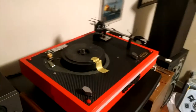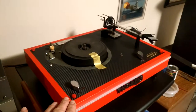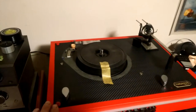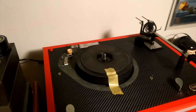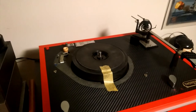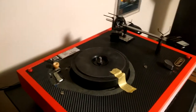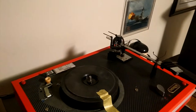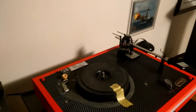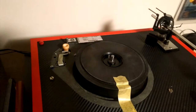The inner platter is where the post sits inside the bearing, and the bearing is probably the most delicate and most engineered part of this whole table - what really makes a Thorens table so good. The TD-165 is like the TD-160 but came with two different sized posts and bearings. The less desirable ones are the seven millimeter bearings; this one is more desirable because it has the same bearing as the TD-160. It's a much wider bearing filled with oil, with a little post that rides on a conical steel shaft in a pivot hole at the bottom.